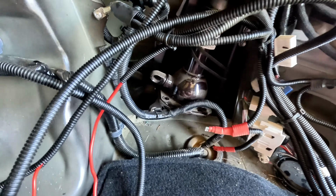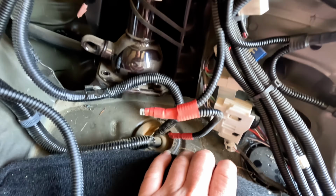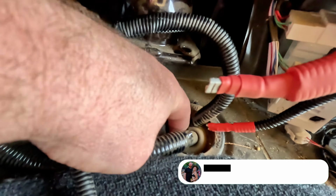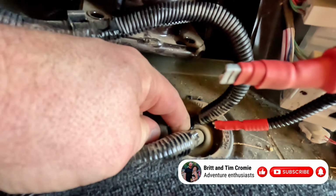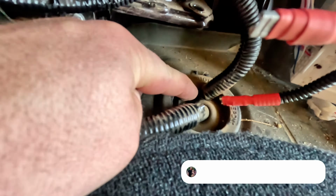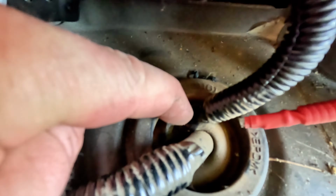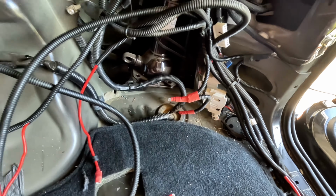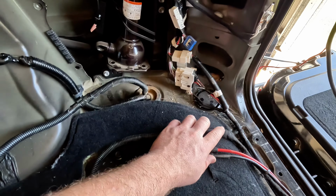One thing else I've noticed is the amount of dust and stuff coming in there. There's a wiring cable that comes up through this rubber grommet on the floor, and it's pretty much just been chopped. I don't know if you can see that, you can see down the floor. So I'm going to seal all that up too, just to stop some dust getting into the back here.